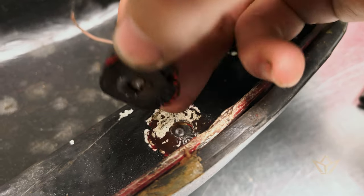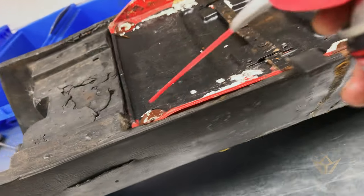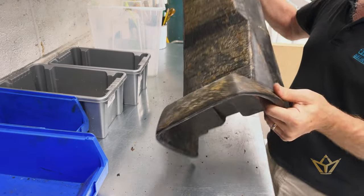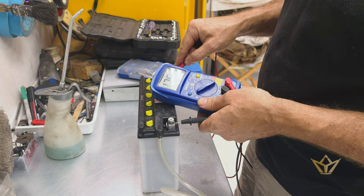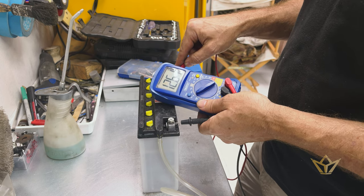Here's the first challenge. I'm putting on this amazing stuff — WD-40 Specialist Fast Release Penetrant. I especially like to use this when I'm trying to get rid of things exactly like this problem. Without it I would have probably snapped off at least another two or three. The battery is reading 12.61V — not bad considering. I'm going to put it on trickle charge and then just see how long it holds that charge.